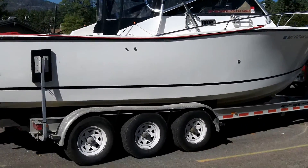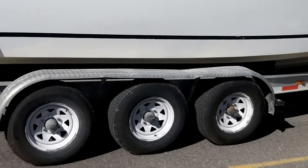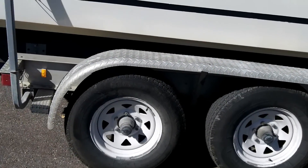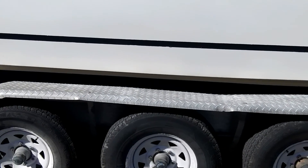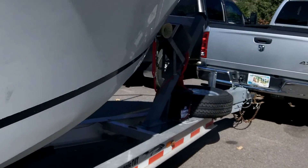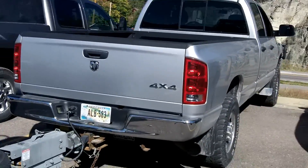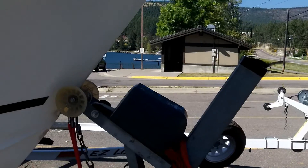Let's talk about capacities first. If at all possible, select a trailer with three 7,000 pound axles. Those would be six-lug axles, preferably with brakes on all six wheels. The reason for this is when you're traveling and towing, you're going to find that unless your trailer does most of the work, the truck is going to take a lot of stress in the brakes.